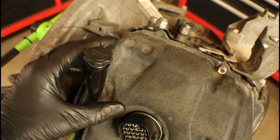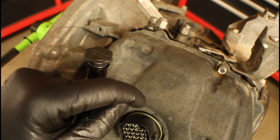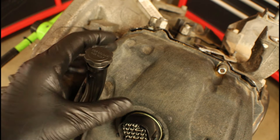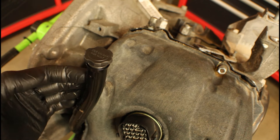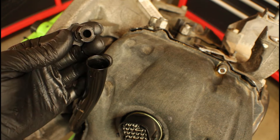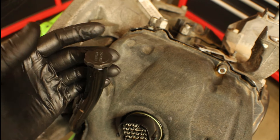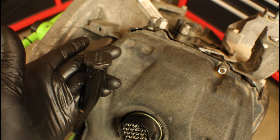Other than the test drive, the next thing we've got to do is make sure there's fluid in the transmission. If you dropped that lower pan and replaced the filter, you're going to need to start out with four quarts of ATF4. If you did the basic repair procedure and didn't drop the lower pan, we still need to check the fluid level to see how much we may have lost. Now, this cap on the dipstick tube — there's no dipstick. To check the fluid level is going to be a bit of an issue, so if you look up in the corner of the video, I'm going to give you a link showing how to check the fluid level and how to do it without buying the special tool that's required.